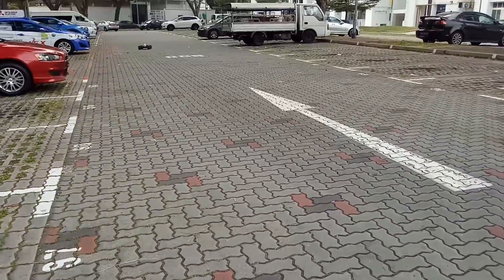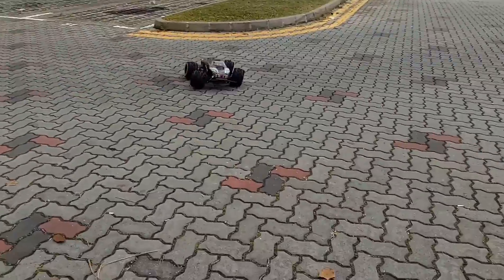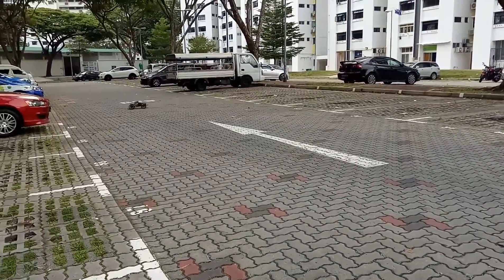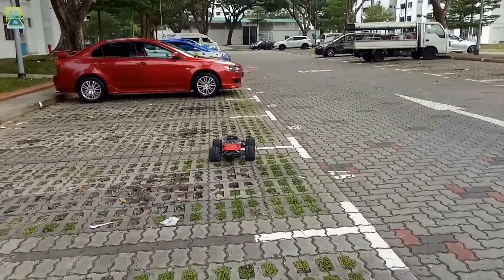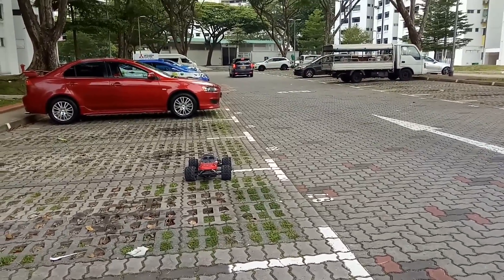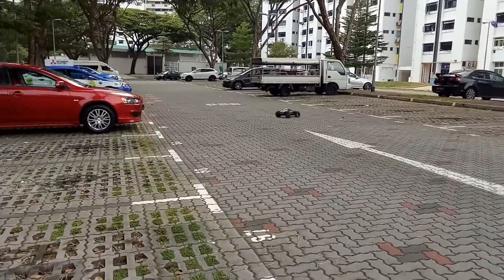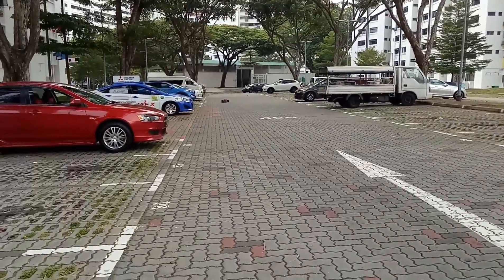Let's bring it around. It's got some good cap around it. You can see the front wheels ballooning a little bit. Maybe the reason the car is not rolling is possibly because the bearings are worn out. The center diff is 500k, front and rear diffs are 100k, so I don't know whether that contributes to the car not really rolling. But it's got a nice, good pull on the ground — smooth acceleration, no crazy release.